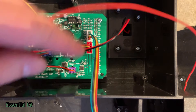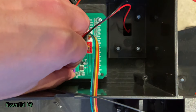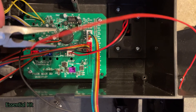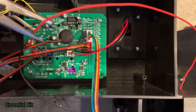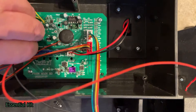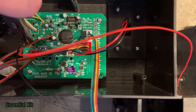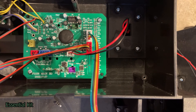Use your fingers or pliers to pull on the housing — pliers helps a lot, especially with the wand. Once you remove that connector, put the motherboard aside for now. While we're here, go ahead and remove the rest of the connectors as well.